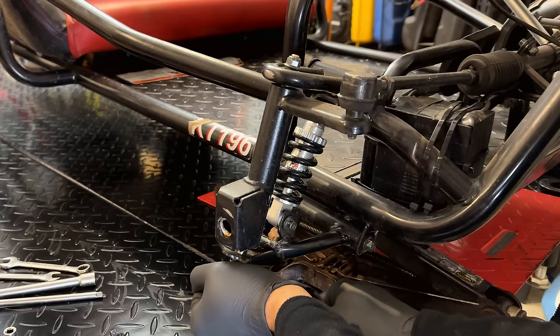All right, good. We are now roughly set to 3600 RPM when that is touching that set screw. Now, I did notice the carb was still surging a bit, so we might have to go in there and drill that out a little bit more. But I think things are going to improve once we get the airbox installed, and of course, once we add that chain back, the engine will actually be under load and the main jet will come into play.